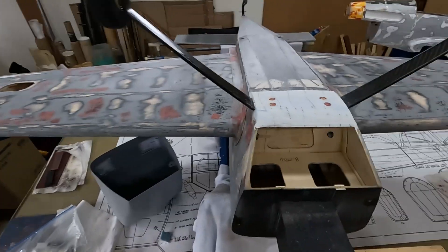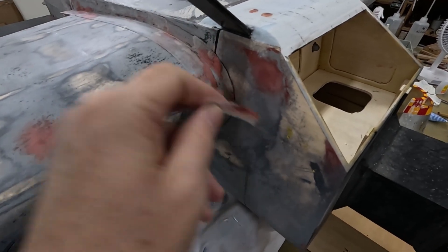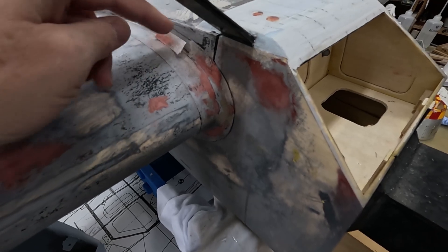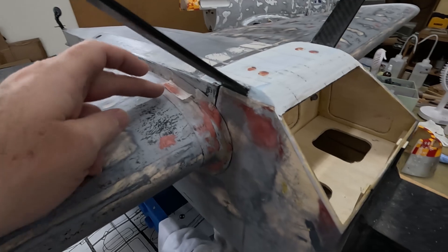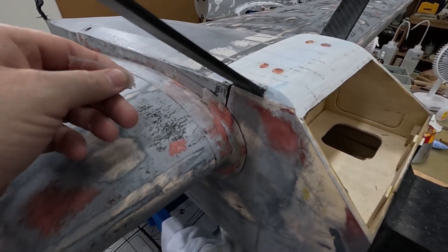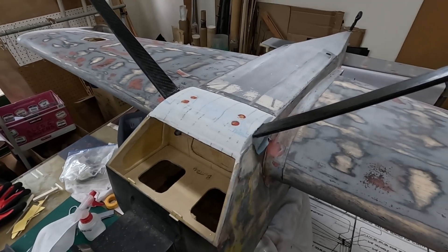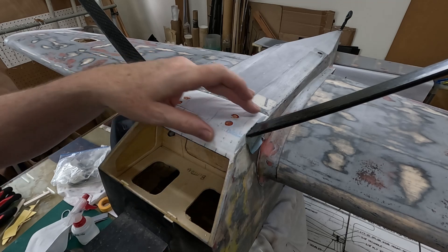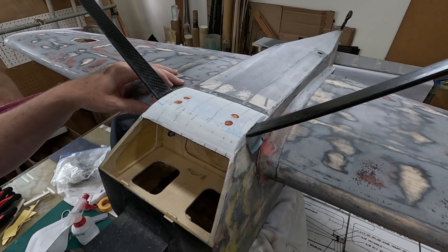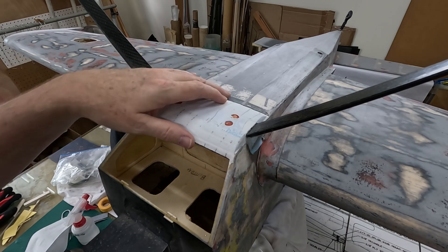This piece — the fairing, the wing-to-fuselage fairing — I actually tore it off. I think it'll be okay; I can glue it back in and it actually glues to the belly pan, so I think it'll be fine. Glue it in, putty it in, and it'll look fine. But it just kind of shows you the issue with clear packing tape. It's good as a barrier, but you do have to be careful when it comes time to remove it. I try not to burnish it down on areas that aren't having fiberglass formed over them — I just kind of put it down lightly. I think it has something to do with the primer — I think the lacquer primer and the adhesive kind of interact.